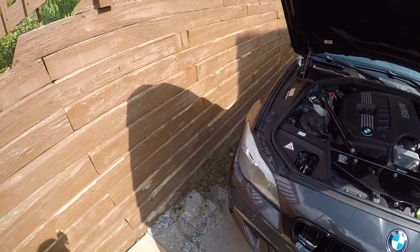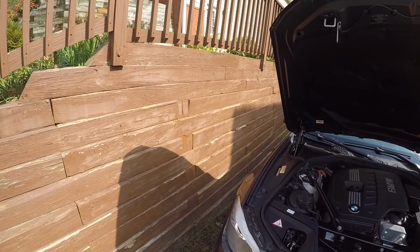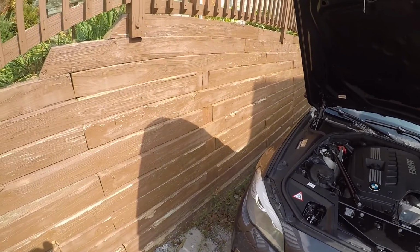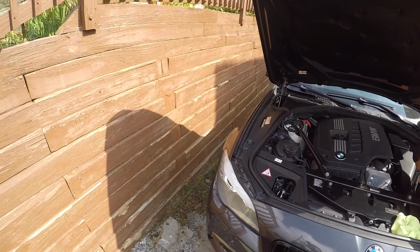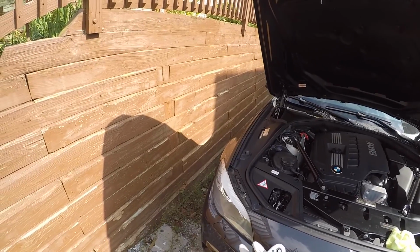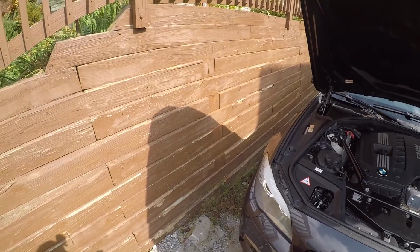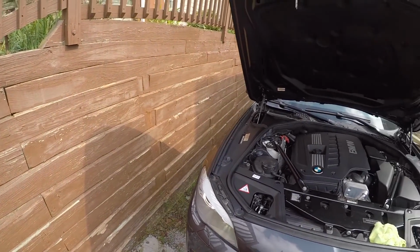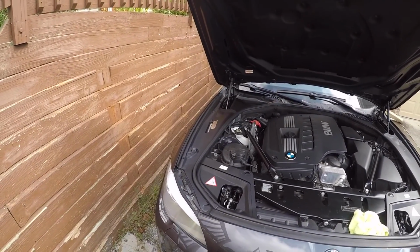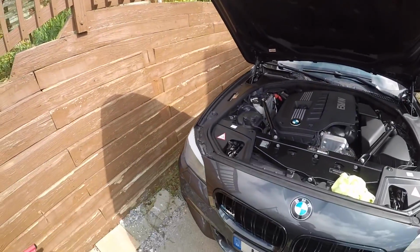And then, one thing to note, it comes in a 1/2-inch socket size, so I wanted to use my 3/8. I do have a 1/2-inch breaker bar, but it's very big, and didn't need that big a tool here, so I wanted to use my extending 3/8 ratchet I have, which is really, really cool. So I just used an adapter to go from 3/8 to 1/2-inch, and luckily that was actually the right size of extension I needed as well, because we tried to use a 3-inch or 4-inch extension and made it too long. So anyway, all this seemed to work pretty good.